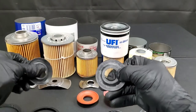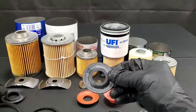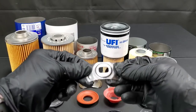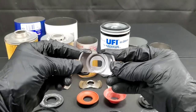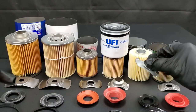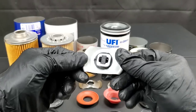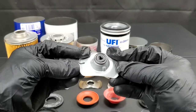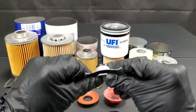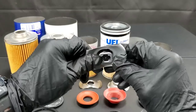I will say there are a little bit harder gaskets on some, however these gaskets appear to be much softer. AC Delco left, Motorcraft right. Let's check out the stamped piece of steel used to hold the components inside the oil filter housing in place — such as the filter media and anti-drain back valve — for the Mobil One. You can see the Toyota filter uses a stamped piece of steel as well. It's just like a pop can — really isn't that strong. I really do not like this design and I've shown in previous videos why and how it can cause major problems.